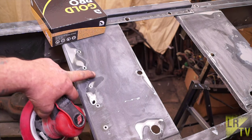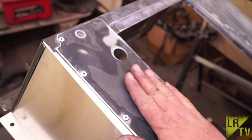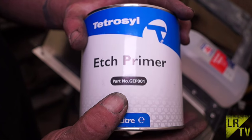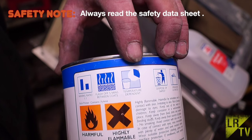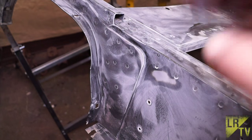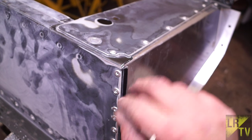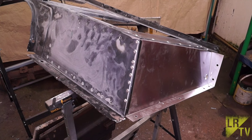You can see the differences in paint layers because the panel is quite uneven. Preparation is the key to a good paint job. Fresh aluminium needs to be keyed down and it needs to be etch primed. This is a two-pack: etch primer and an activator. This stuff is quite nasty to the respiratory system and it's highly flammable. A certain amount of information is available on the tins if you're spraying or brush painting, but get a data sheet as well. You can spray aluminium and prime it, but because you have certain bare edges after keying down, you're going to need to prime these with etch primer — including on the aluminium rivet heads. This will give you the best possible results when painting.